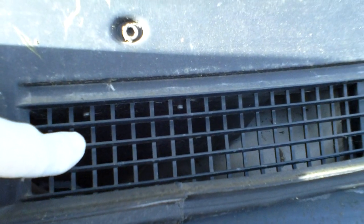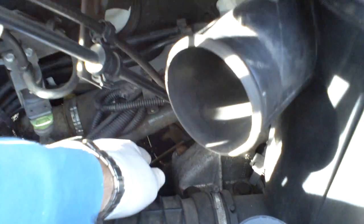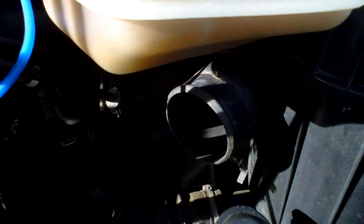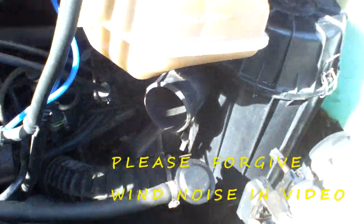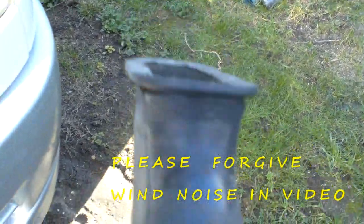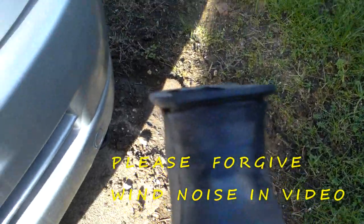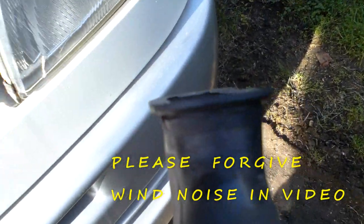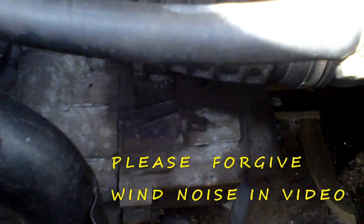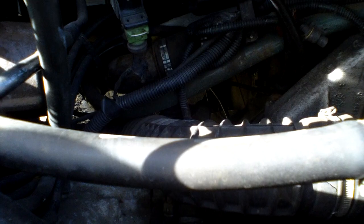Right, next job is to sort this out. Down here you've got a pipe and the pipe drains down and it goes over the back there to the other side of the gearbox. I've already moved this air filter pipe so I can get at it, removed it and cleaned it up with a wire brush. But the trouble is this is all loose — it's supposed to have a groove there and be nice and tight, but there's no seal there. So what happens is the water drips out, lays down here, goes all over the gearbox, which is bad news, and you can actually get water ingress there. The idea is to clean it all up and sort it out.